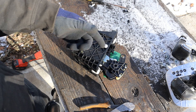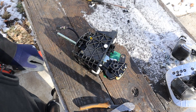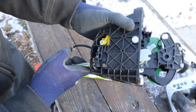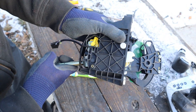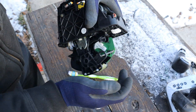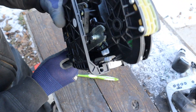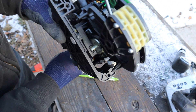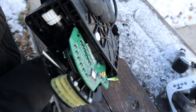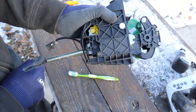Now a DSG is basically an automatically, electronically shifted manual transmission — that's why you can't do this entirely electronically. Because you're using the same shifter handle to move back and forth through your manual gear selection, there's this little black arm over here that's going to re-engage this piece to the black plastic piece so that you can move the rod back and forth when you want to switch directions. So as I move this from drive to manual mode here, this little black arm re-engages. There's also one on the other side doing the opposite thing, and then once it re-engages, you're allowed to move the whole thing as one assembly.